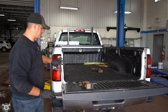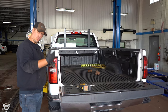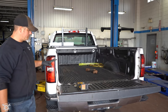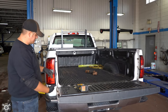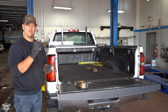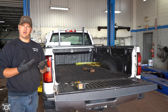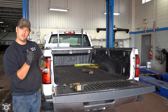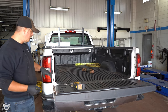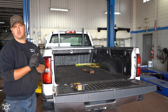The difference with some cars and vans is they'll actually have a hatch — you don't have to remove the tail light. You just remove the hatch and reach your hand in and twist the bulbs out; they sit in there the same way. Some other trucks and vans, instead of having screws, will have a push plug. You take a flat screwdriver or needle-nose pliers, pull the center section out, which allows the inside to collapse so you can remove the plug and take the assembly out.